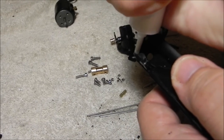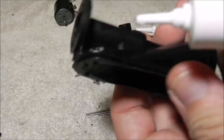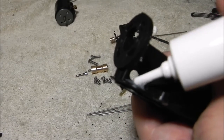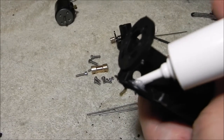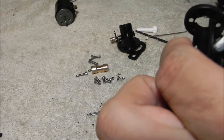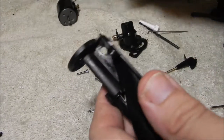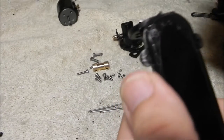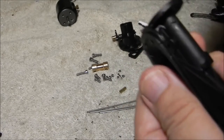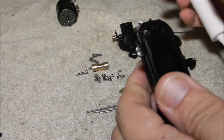The reason I do it now is it's actually better to fill this area with a little bit of silicone — you want to get it coming through the holes a little bit, down in there, which will help with the seal. After getting it into those holes, you're kind of pushing it down in there a little bit. Just wipe off the excess — I use a towel when doing this. You can actually see a little bit of silicone right there, and you don't want to make a total mess of it.